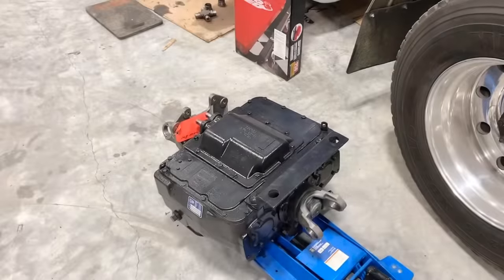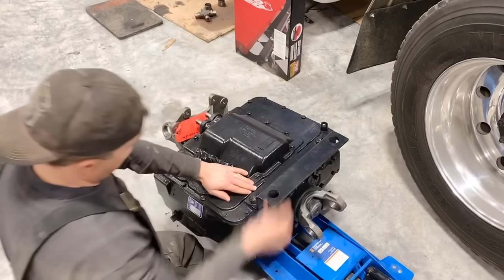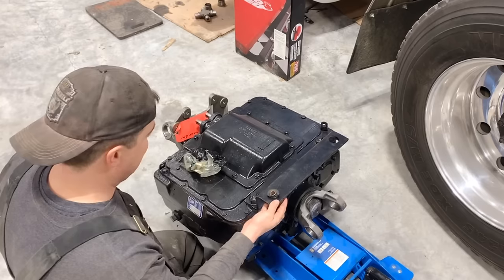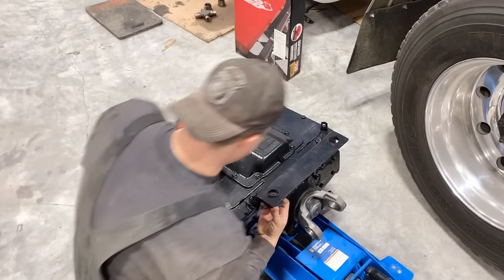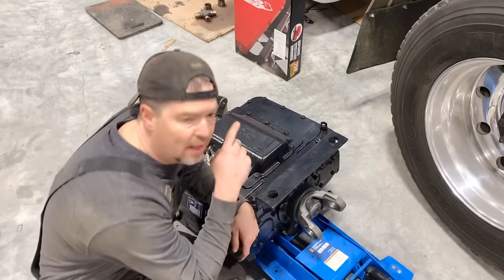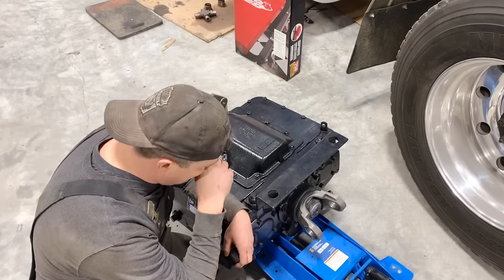Okay, so these bushings that support the back end. This goes up over the cross member just in front of the pogo stick there. And these old bushings were in here like this. And that sits on the cross member and supports the back end of the transmission. And then there's two bolt holes that the bolts go through. So the gear center was having a heck of a time trying to find these. To clarify, this truck wasn't actually a twin stick truck. I know probably a lot of people are surprised, but originally it was a deep reduction 15 speed that somebody converted somewhere along the way.